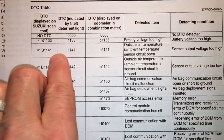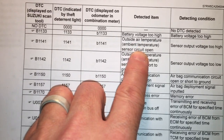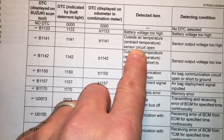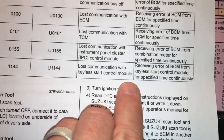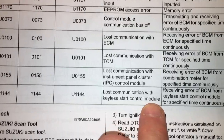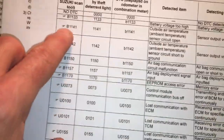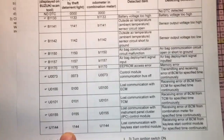The codes I actually had were B1141 and U1144. I'll put the link up to when I demonstrated the automatic air conditioning procedure where you can also retrieve codes — I actually had a sensor disconnected at that time. Perhaps I didn't go through the reset procedure and it's been in memory the entire time, so that makes some sense. The other code, U1144, is referring to lost communication with the keyless start control module. I don't have the keyless start option, so there's no control module for that — although you'd think there would have been an inhibit. If you don't have the option, maybe there's some scenario that can flag this code spuriously. Those codes do make some sense given there's some history with respect to them, and since I don't have this option I feel quite comfortable resetting them.